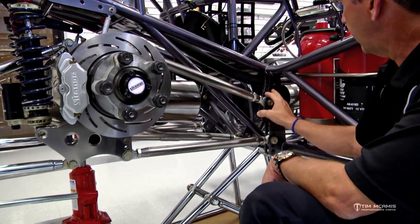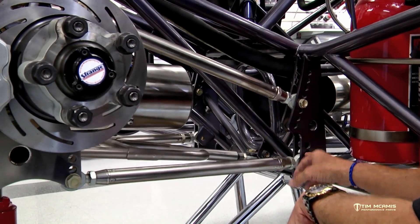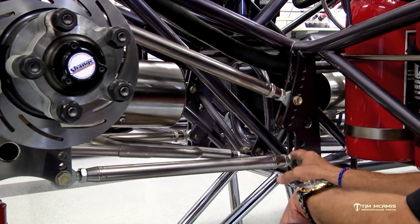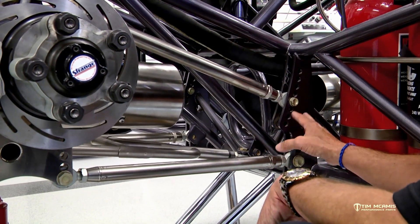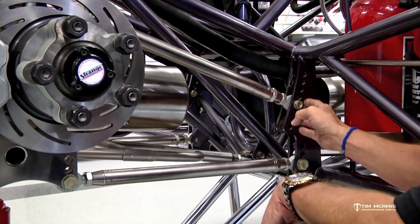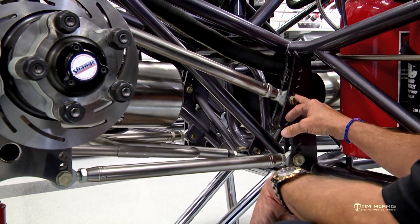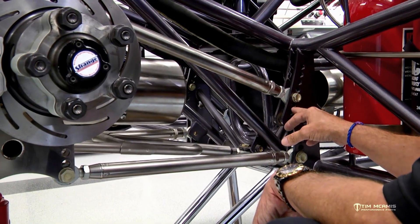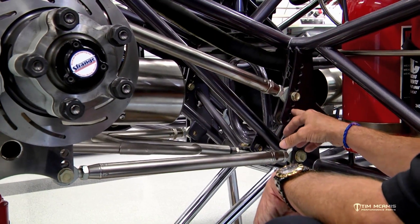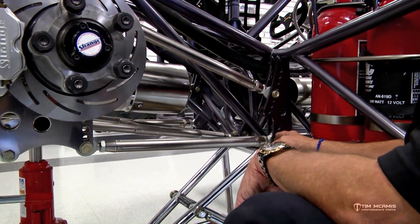This car has standard brackets in it, so we have a given hole setting, top and bottom. The top holes are a little smaller and closer together, and the bottom holes are a little farther apart. We have two different types of brackets: this standard hole bracket, and also the adjustable bracket that has slides in it. You can leave the ride height static on the car and move the slider brackets up and down to get incremental adjustments of an eighth inch, where these you have to move from hole to hole. The adjustable brackets will be a lot finer of an adjustment.